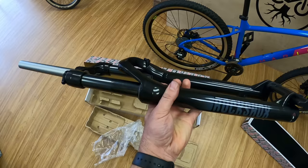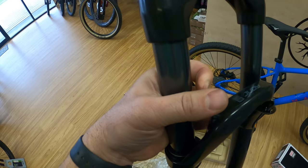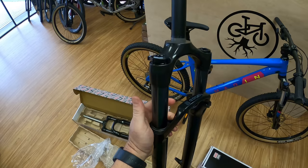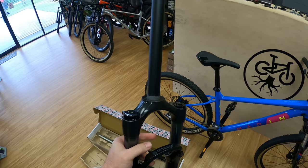Most beginner bikes are going to have a straight steer these days. Some will have a tapered, but you could use a headset or lower cup adapter. These forks also aren't through-axle or boost spacing — just a nine-by-100mm quick release. So if you're on a budget, this $169 Judy air fork is what we're installing. It has 30mm stanchions, which is fine for most people. If you're a bigger rider or want something nicer, you could spend $250 on the RockShox Recon, which has 32mm stanchions — it's a stiffer fork.